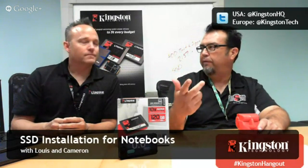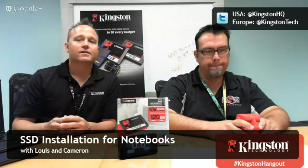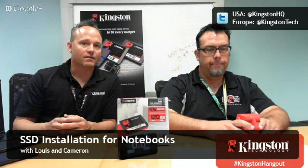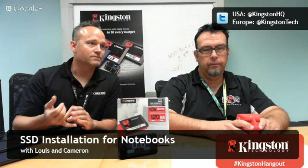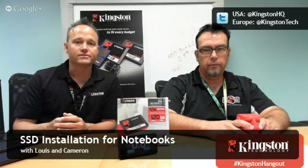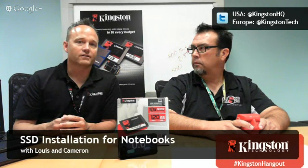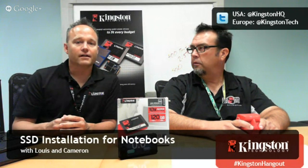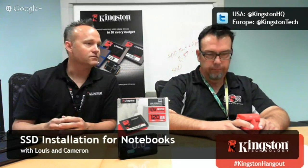How about in enterprise? You've got RAID 10, a popular one. RAID 5. Yep. All of those are supported. The latest generation of controllers from the top controller suppliers are supporting SSDs now more than they ever have. So we're seeing not only great performance, but great compatibility with SSDs. A lot of our SSDs are used behind RAID controllers. So really no limits in terms of use with RAID. You're going to get great performance out of adding multiple drives to a RAID array.